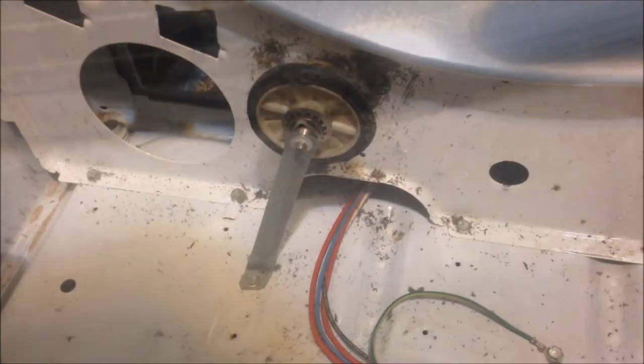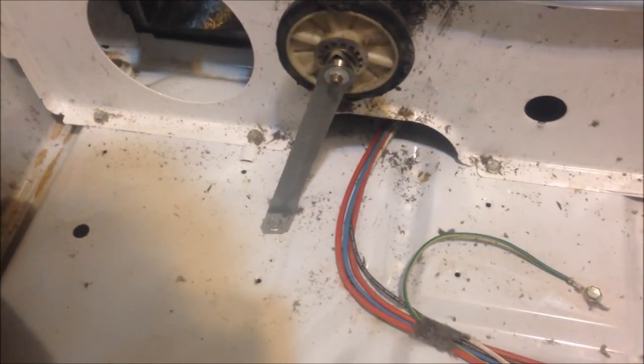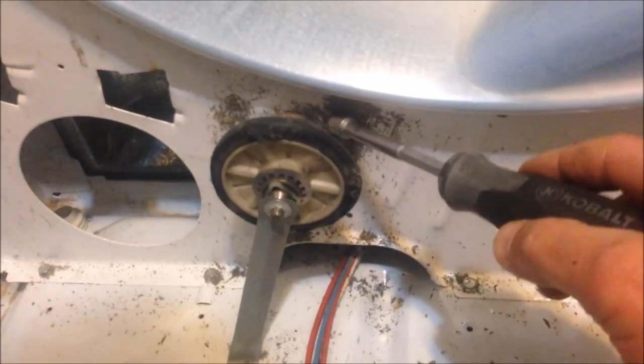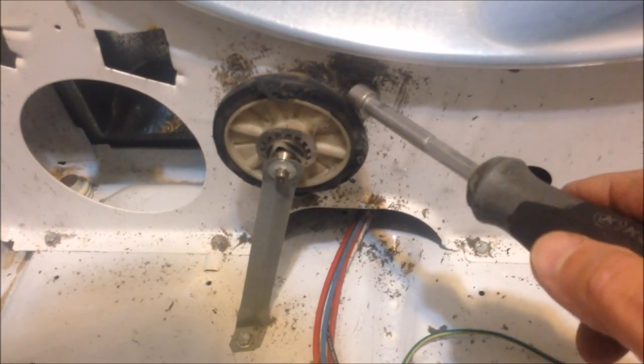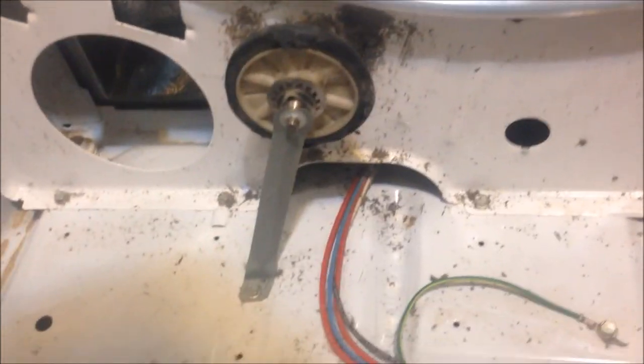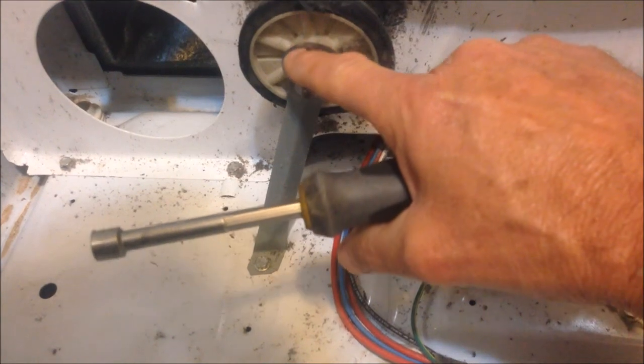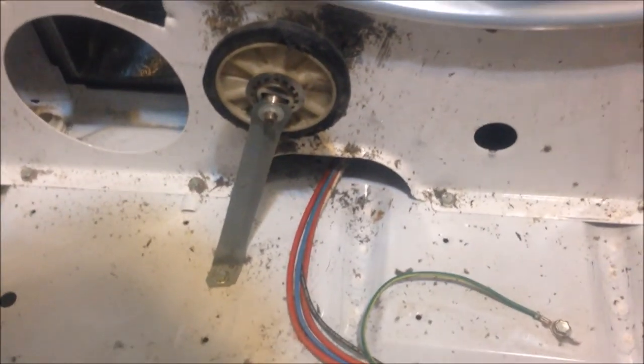One of the things I'm going to have to work on in this drum — where the rollers have been disintegrating — it's left these deposits here. I'm going to clean that up because it's going to leave a little bump. But once I get this cleaned up and get the rollers replaced, it should run pretty smooth. We've vacuumed out some of that loose material, lint, and stuff. But the rubber has adhered itself pretty well — it's pretty gummy back here. So the next thing we've got to do is remove this brace and this little triangular plastic piece, and that will enable the wheels to come off and be replaced.